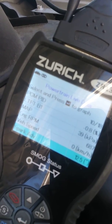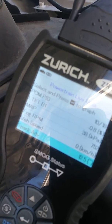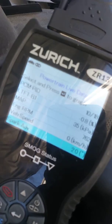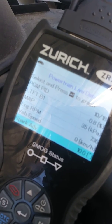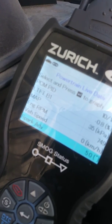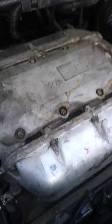The RPM shot down to about 6 or 7. So what I'm doing right now is pulling out the coils. We suspected two of them — they were replaced and we suspected them to be producing not enough voltage. Right there it's out. When we pull it out and insert it back, there's no difference in the car. So it's probably not even firing — it's not firing at all right there.